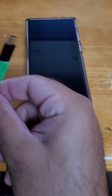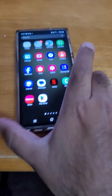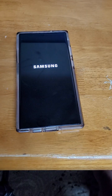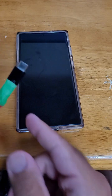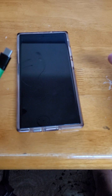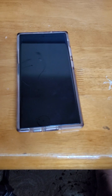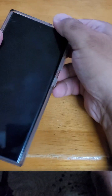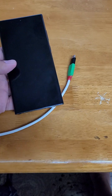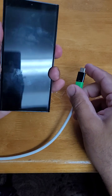What I'm going to do is turn the phone off. Once the phone is off, I'm going to put this cable inside the phone and then press the volume up and volume down buttons simultaneously — press them together a few times. I'm going to take the cover off, as it makes it a little easier. The cover is off and the phone is turned off.